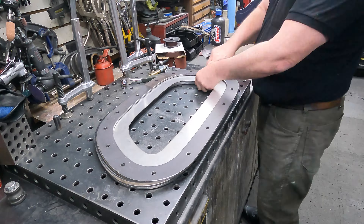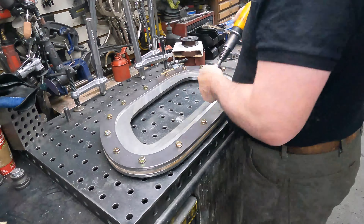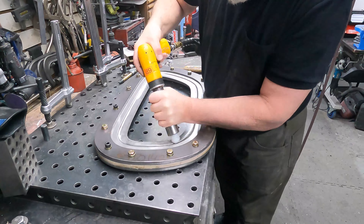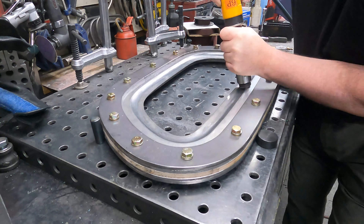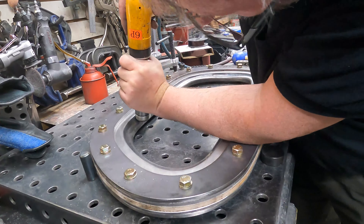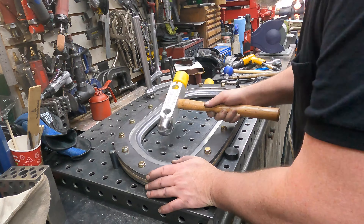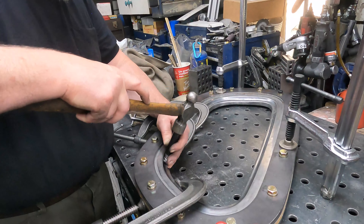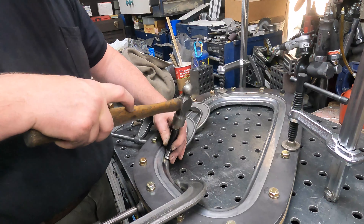I hope you had an opportunity to view the last video where I showed you how I made these steel hammer forms in order to produce the stainless steel grille parts. I'm using an aircraft rivet gun here — not an air hammer — in order to knock this out with some tooling I purchased from TM Technologies, as I continuously broke the tooling I made myself. Don't forget to support those local folks. Here I am just chasing the rest of that grille out and moving around to the finest details before we get going.